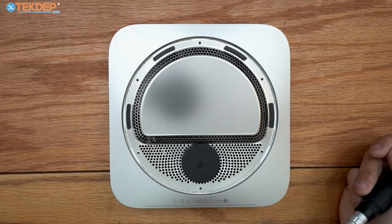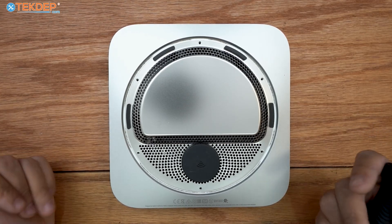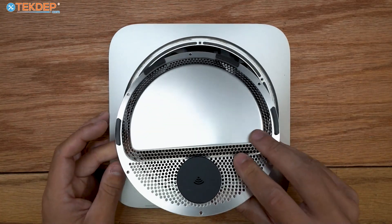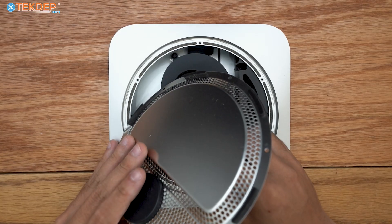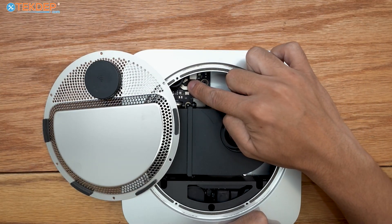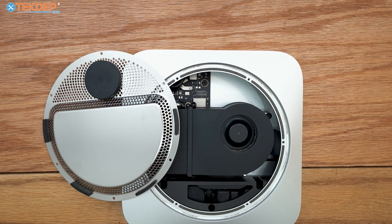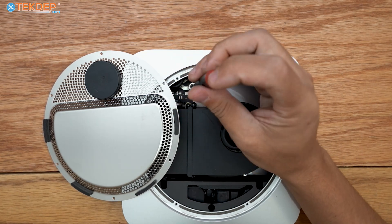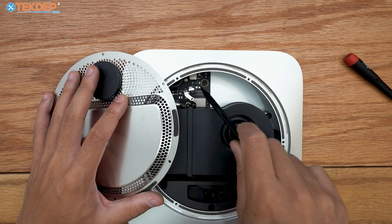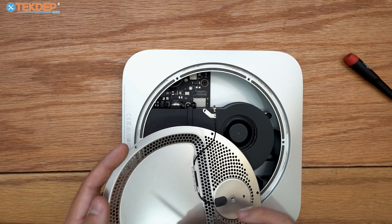This plate is actually your Wi-Fi antenna — it's a large plate that helps send your Wi-Fi and Bluetooth signals out. We'll remove the plate, but it is plugged in. Right above my finger is where the antenna runs to on the board, so we have to take out this T5 screw and unplug the Wi-Fi antenna. With the retention bracket released, you can see this cable runs all the way to the base plate.